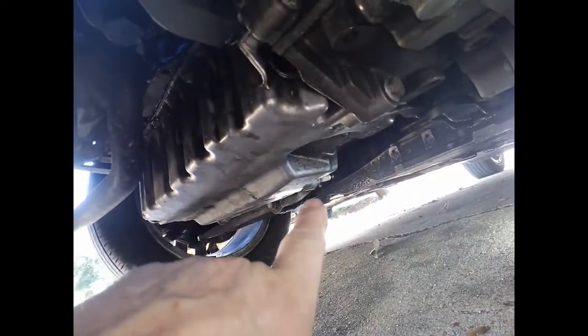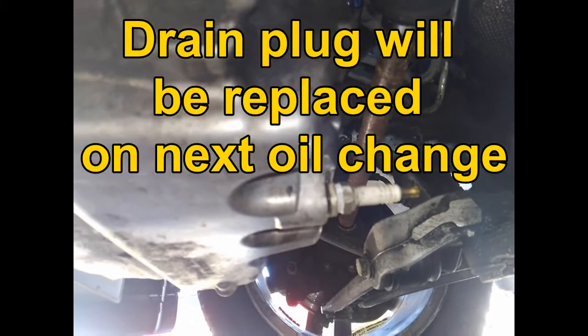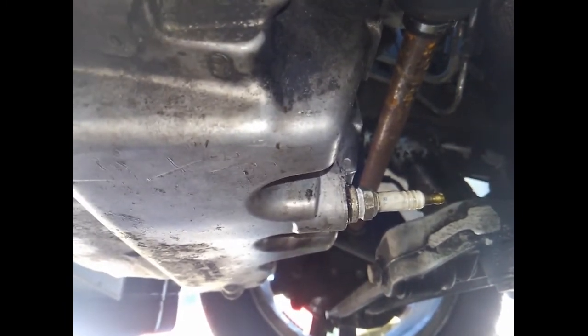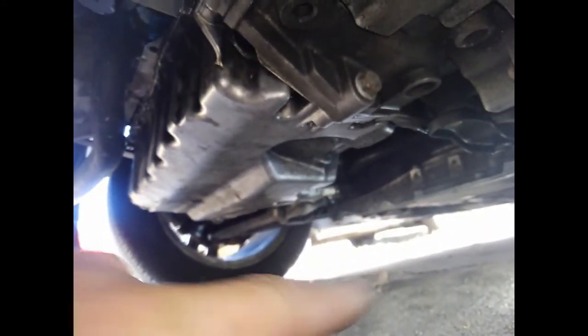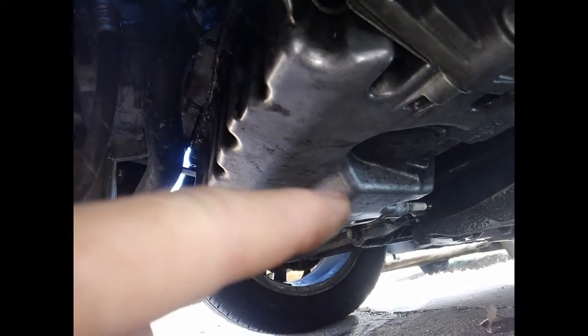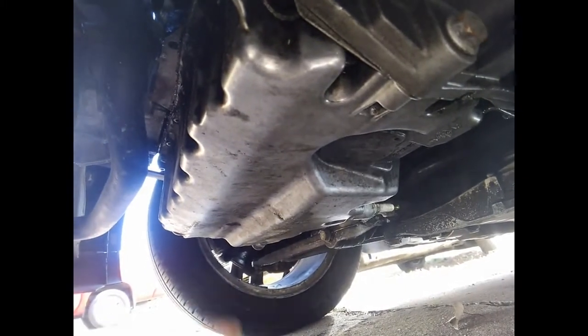Because it's a 14mm 1.25 thread, I ended up using an iridium spark plug out of my SL500 with a C55 AMG motor. I replaced all 16 of the spark plugs, and that's the only thing I knew that had the correct threads. It's been a couple weeks and it hasn't leaked a drop. I used red Loctite on the outside of the insert, and since I didn't have a rubber gasket, I put silicone on the threads of the spark plug and let that seal it. It doesn't leak at all.